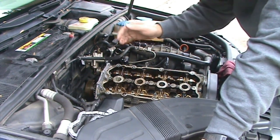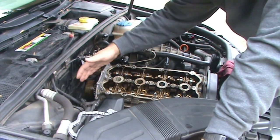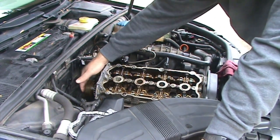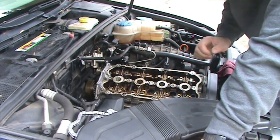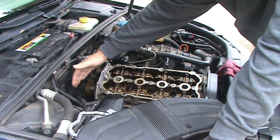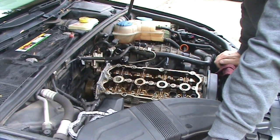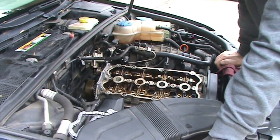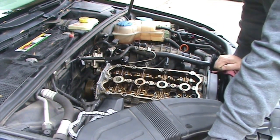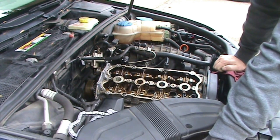On top of that, you put the poly socket on here and go to loosen this screw. It doesn't get put in there that tight, but over time it torques itself down tighter and tighter. If you do get this screw out, you'll need a new one because it has definitely been stretched and you don't want to reuse it. But you put the socket in there, try to loosen it, and you're going to need about a 2-foot breaker bar, and your socket breaks in half. And you bought a great socket, $30. I'll put a link for it down in the description. If you snap it in half, even during correct use, they won't replace it.